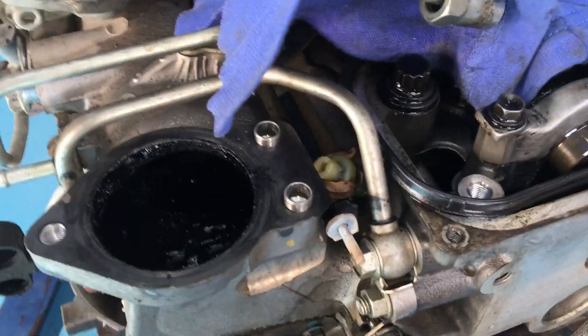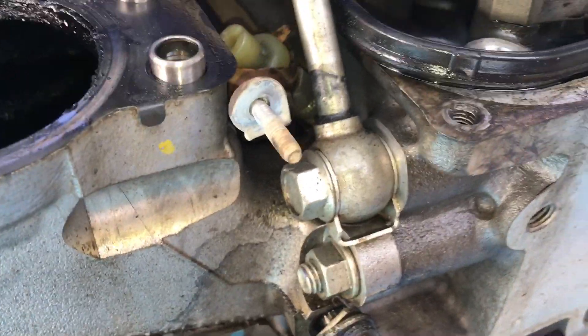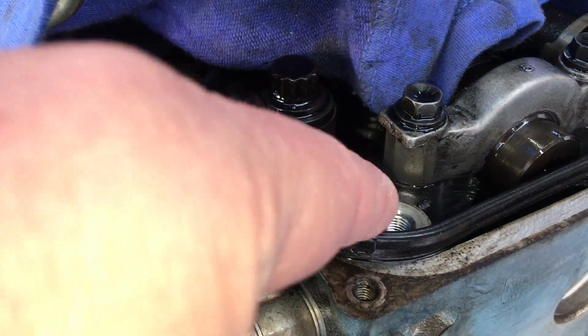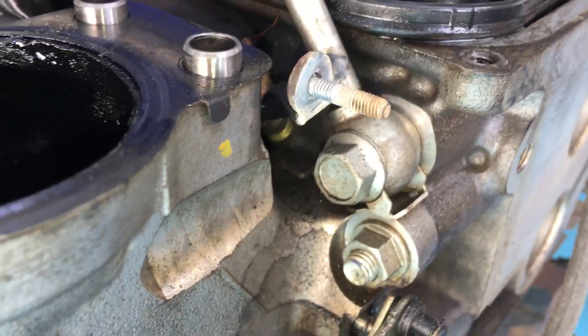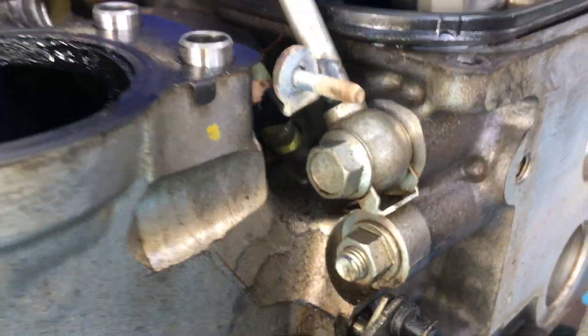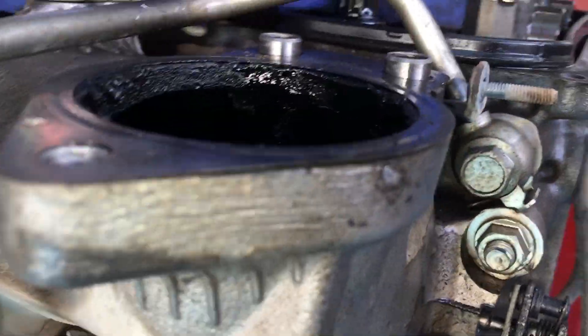it does have a little single-use-only gasket — that's this one here. It goes back on the fuel return line, same as the ones inside. There's one that goes in there and goes along to the injectors — that's another story — but this one is the same thing but a different size. The large one goes outside here.